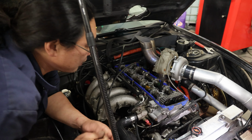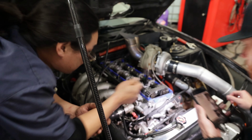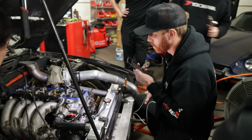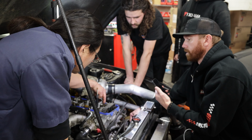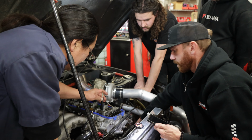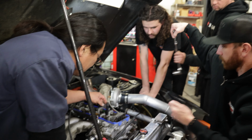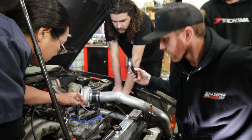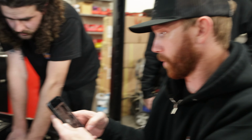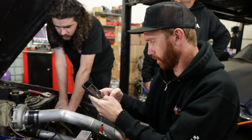Okay, you guys want to turn the crank back and forth a little? Just make sure that the marker you have is a zero. Because this is way too low compared to the picture you showed me. They should be even, and I know that they're not. No way this is that low. So that would make sense why it would torque up quick, but then fall off. Yeah, it falls off.